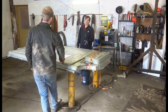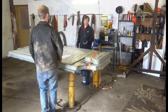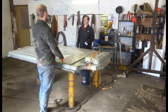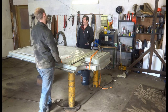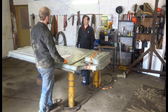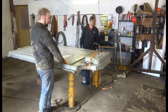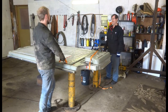Okay, so this car is a 2013. And it had 250,000 kilometers on it? 250,000 miles. Miles on it? Okay. So by doing this diagnosing on the pack, I think this pack has healthy between 100 to 150,000 kilometers would be my best guess, based on the degradation. So you think it's about 10% degradation? Yeah. That's awesome. There's no way you could have 400,000 kilometers and not have more degradation than that.